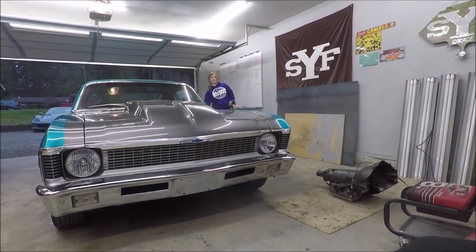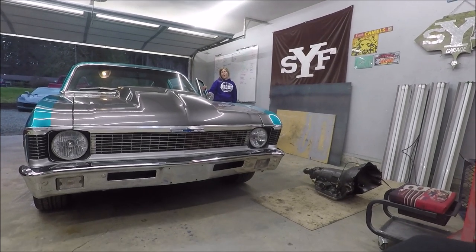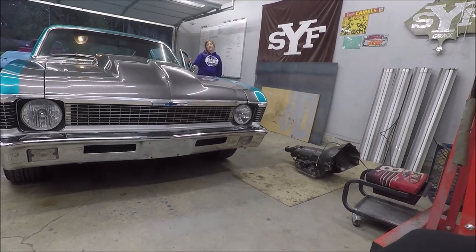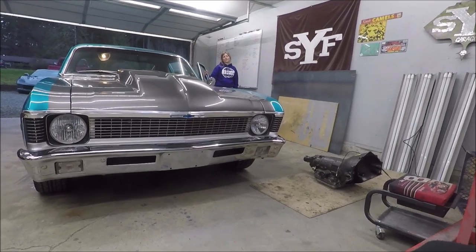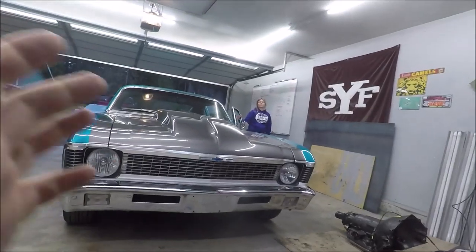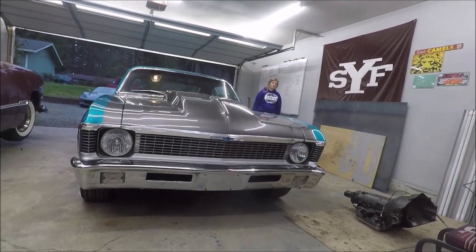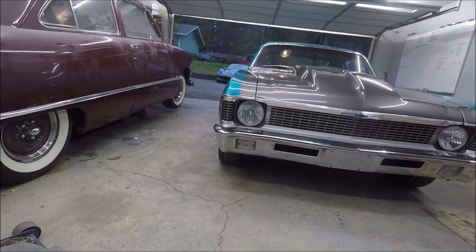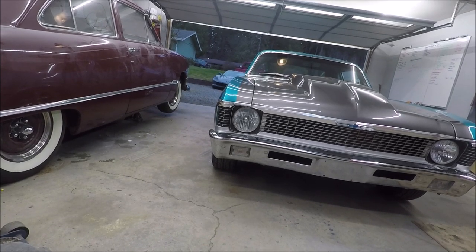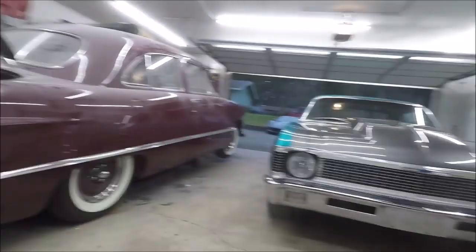Except you still didn't fix your armrest screw. I can't fix that. No, we gotta take the door panel off. Got a hammer and dolly the whole back flat because it's spread open. It's pulled open too much so screws don't grab it. It's been tightened to the point where it pulled the metal up. If you just hammer it flat again, the screw will grab again. At least I think. I could be thinking of something totally different than how it actually is.